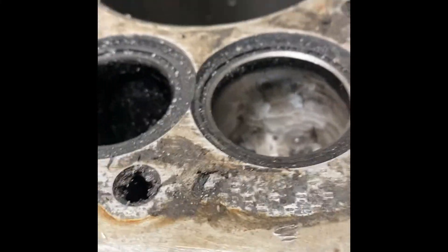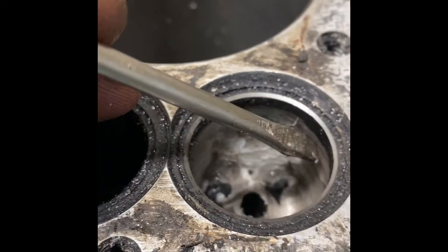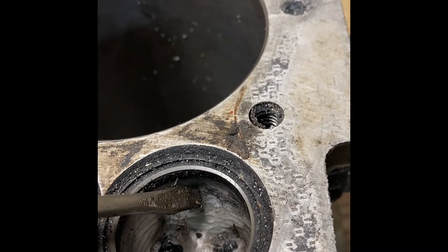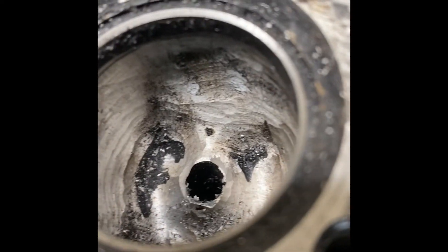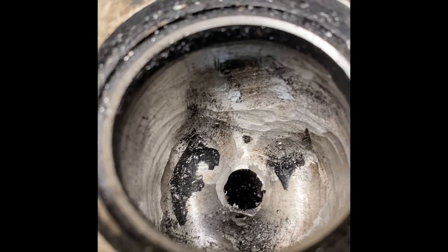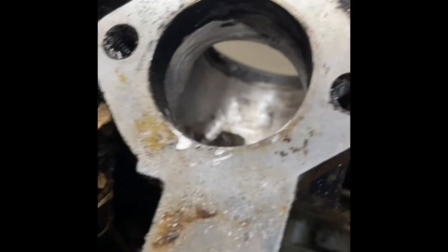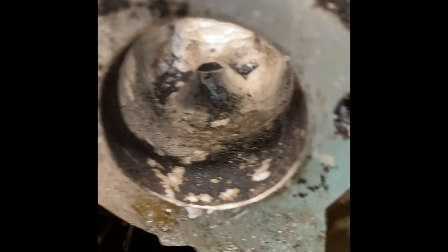If you look in here, you can see where this goes in like this and around on both sides — kind of bowled out. Back here, again lack of material — I can't go nuts with it, but I was able to at least scoop it a little bit and smooth everything out. Any black areas, I left those — I wanted you to see before I do the final cleanup where I did not touch any material. The black is the original port; those are areas we just can't do anything about. Also notice: I never touched the port opening itself, didn't touch much of the roof at all, only went in there to smooth things out. That's what you're looking for.